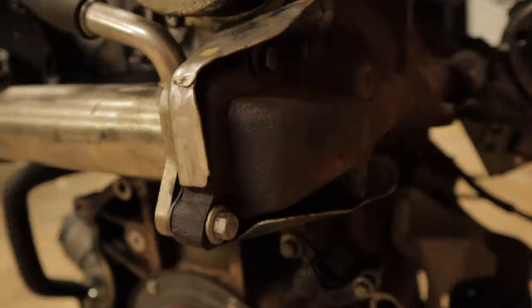So next is going to be just to remove these coolant lines here, that one there and that one there, that we just had off. Nice and simple process. Just move those hose clamps up like so, slide that off. Same as the bottom one here. So there would normally be a plug here, which would just unclip straight out like that. There's also, from this side here, two 10mm bolts coming in there to the actual cooler. So we'll hit that next.